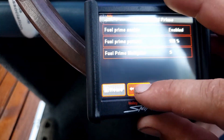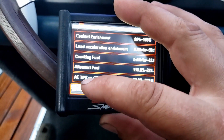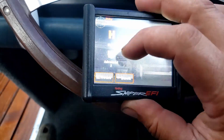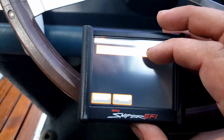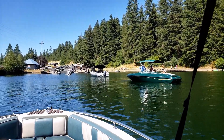I spent the rest of the day messing around with all kinds of settings in the Holley Sniper EFI. There are just so many settings and it really takes a lot of time — tweak one thing, if that doesn't work put it back, tweak another thing. In the end I got to a point where I could start the boat up, let it idle for about 20 to 30 seconds, then drop it into gear and it wouldn't stall and it would run great all day long. Now sitting at the launch waiting for the ramp to clear up, the engine is idling perfect, drops in gear perfectly, pops out of gear perfectly — no stalling. Other than the clicking from that 12-volt separator, I might have to do something else with that.